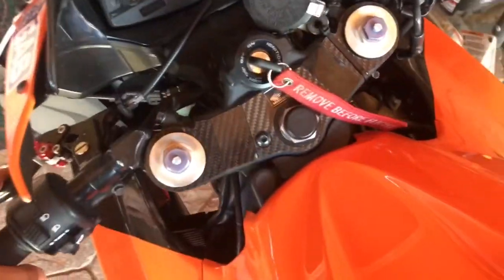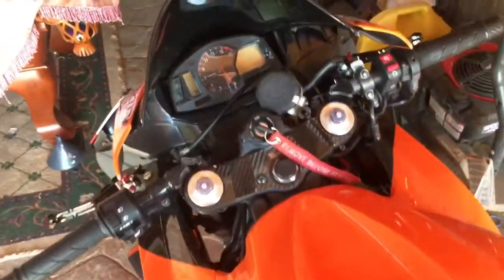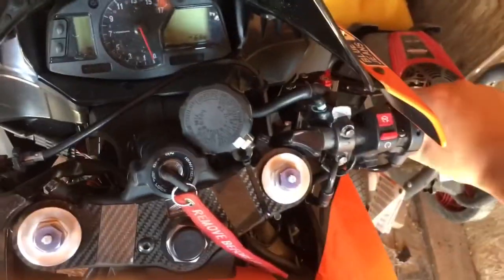All right, so that's at the point where you want to start adding throttle. When you start releasing it, say you already know where the clutch engages and releases, and you know where the bike is going to start moving. That's when you know exactly how much gas you can start throttling and when to start adding the gas. Because you don't want to be on the throttle revving your bike up and then just dump the clutch out.